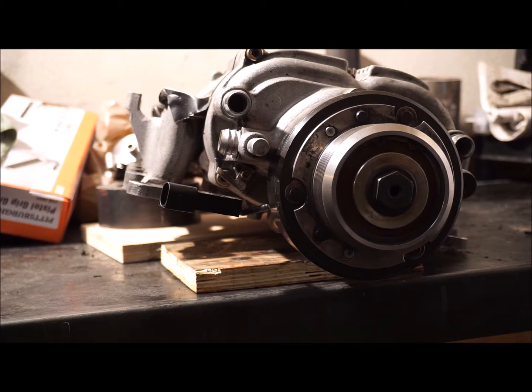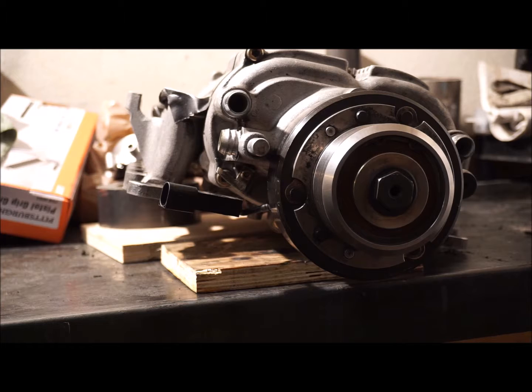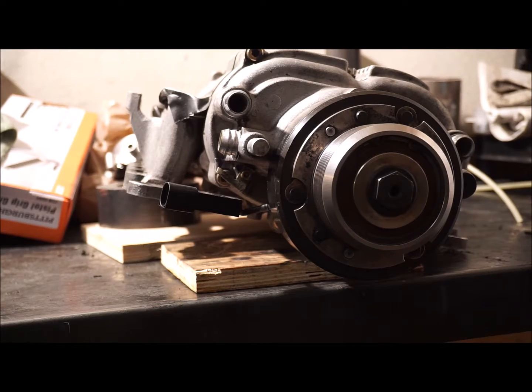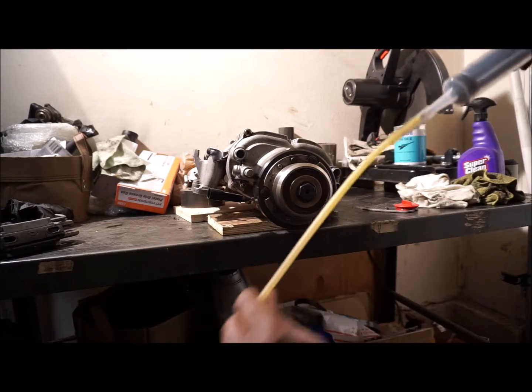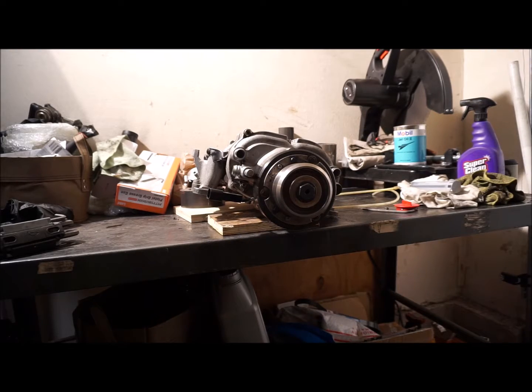My advice: when you're vacuuming up to 60 milliliters, if there's air or any oil already in the tube, factor that in. Keep that in mind - if you need to add more to compensate, fill this up with the oil before you begin. Fill the chamber with the syringe but take into account the extra volume of oil or air that may be in the hose.